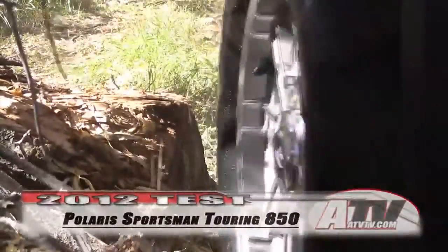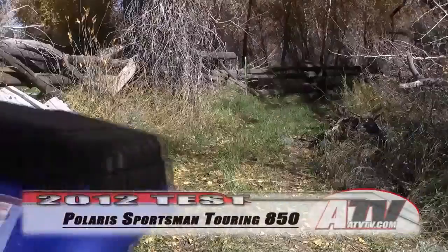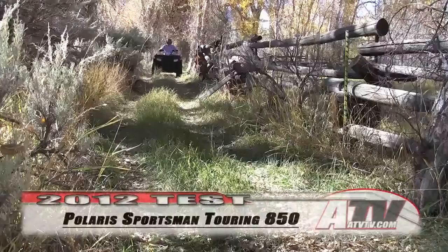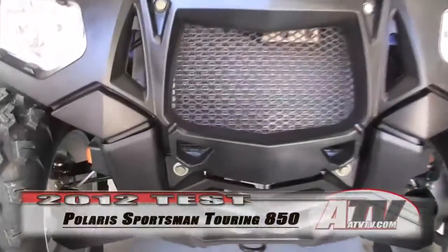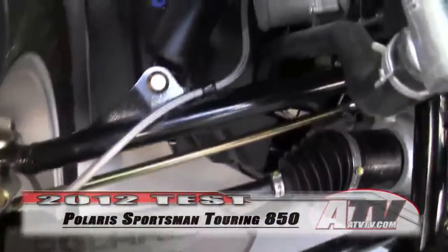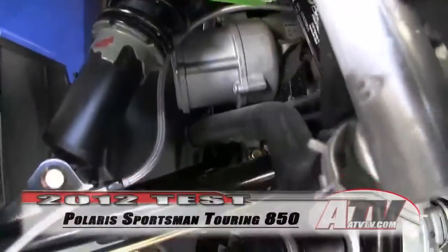On the rear, the XP's A-arms have what is referred to as roll. Now, this means that the arms' mounting points are angled so that the rear tires move slightly rearward as they move upward, thus making the upward travel of the wheel and tire a less abrupt movement when hitting obstacles. The rear suspension has 10 1/4 inches of travel, and there are preload adjustable shocks on both the front and the rear.